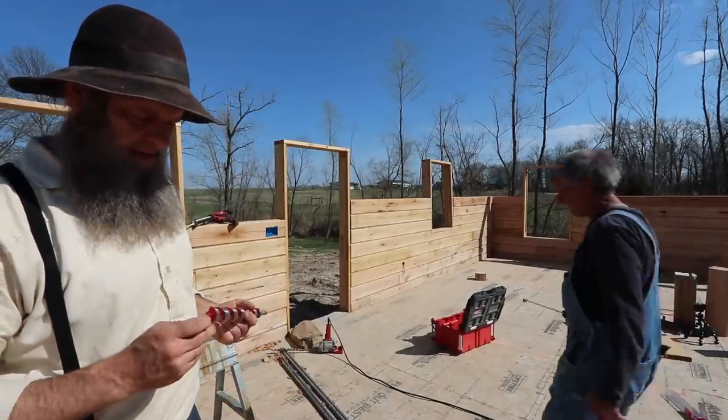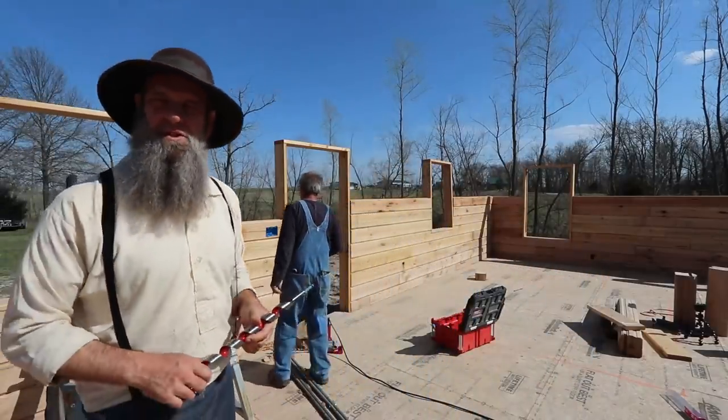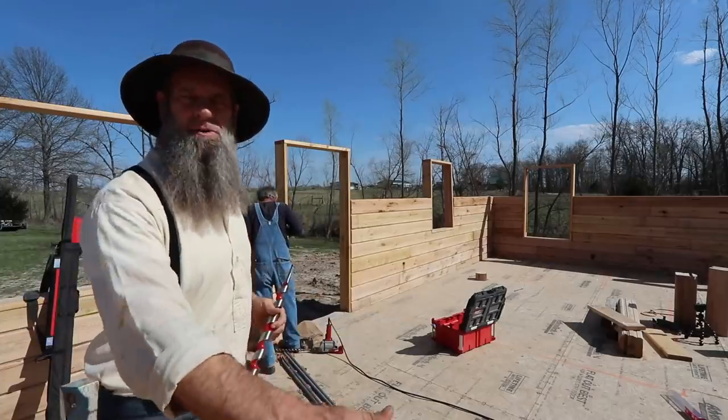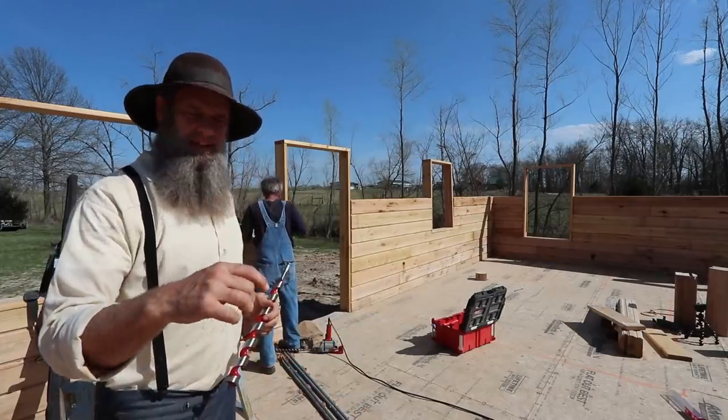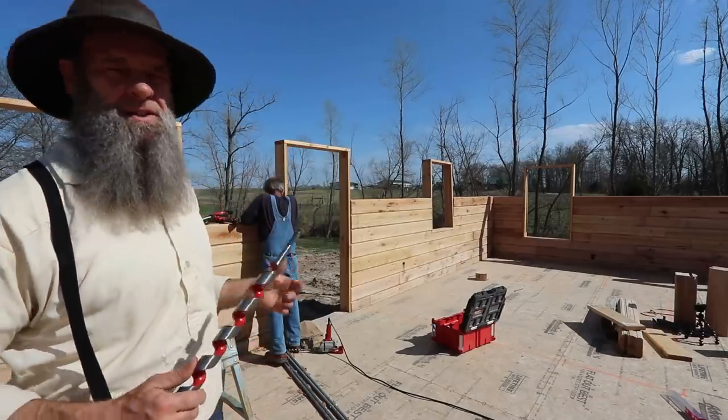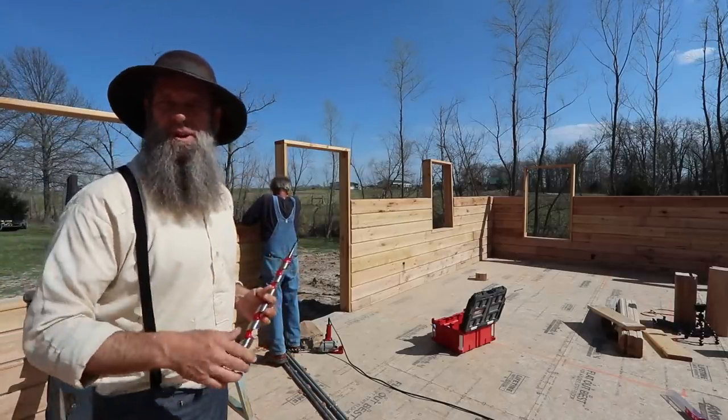And then after Gary came up today, I even asked him. The dump bed on my trailer quit working, and once we tracked that wire down, it was because of a bend. It just rubs a little bit, and over time it breaks and makes a disconnection there. So then I'd have to take the door out and all that stuff.